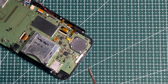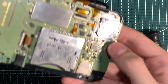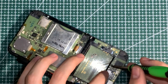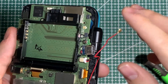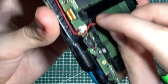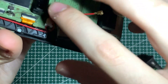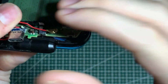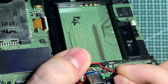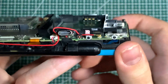Keep the cables routed through both holes, and it should look like it did before we started. Put the battery holder back. Now with the antenna cable, it's got a little snap that holds the cable. Route it through the little notch in the motherboard and press it in — you can see it holds in there. There's a little channel and a hook down there with a little notch; you have to route it underneath and then push it down.